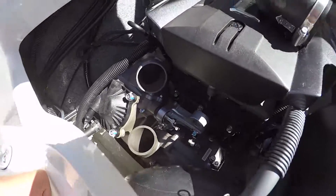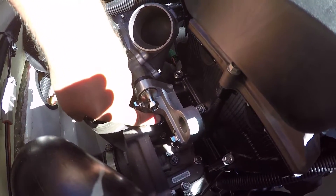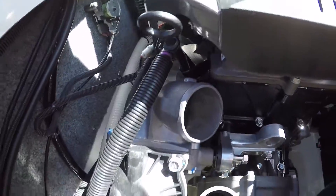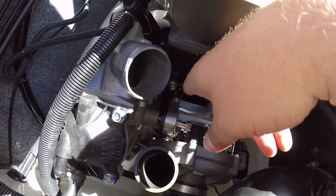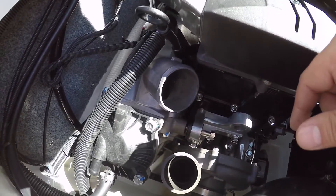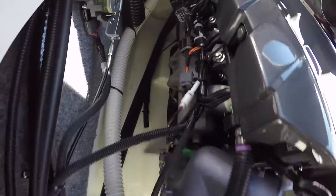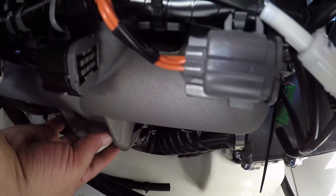Down at the bottom, you'll have a line that comes off the bottom of the intercooler. You'll see a little coupler right here that connects these two lines. Unfortunately my other camera's battery died, but we're going to remove this bolt and the one underneath it. Directly below is the last 14-millimeter bolt — you'll need an extension, maybe two, to reach it. Then take your hoses off, including the one that goes down into your intake manifold.